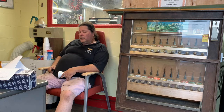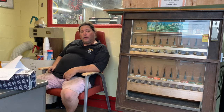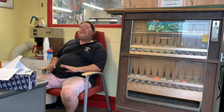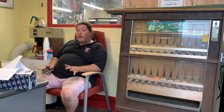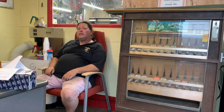It's going to be about brakes. It's important to understand one thing: everybody has an opinion, and I have many myself. But the important thing I have to say is that if you lube those slider pins that I'm going to show you in this brake video, you may never, in your ownership experience, need to buy rotors or calipers. It's a binding slider that causes brake rotor warpage, and the only thing that really should wear in a braking system is the pads. Something to think about. Let's get on with it.